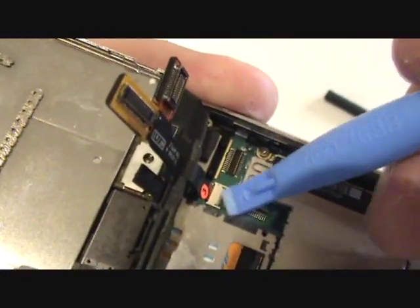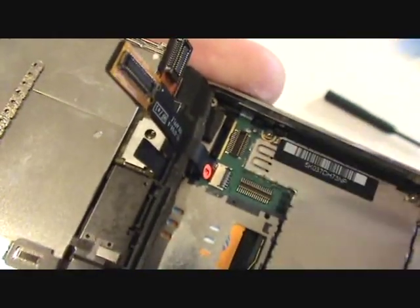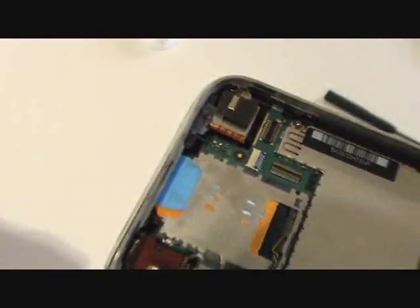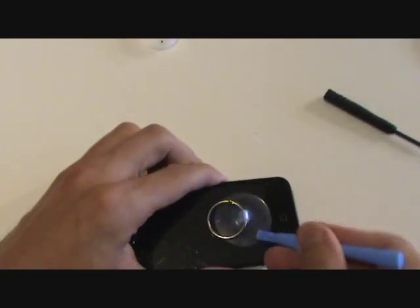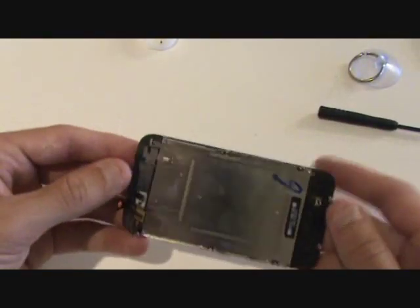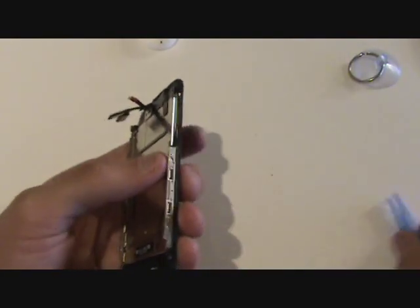I will show you just how that is done. You will take your case opener tool, wedge it just underneath, and lift it so that it sits in the vertical direction. That will release the tension between the port and the cable and it will just slip out. We can set that entire assembly aside and we are only going to want to worry about the front glass and digitizer and LCD mid-frame assembly.